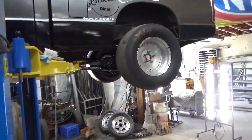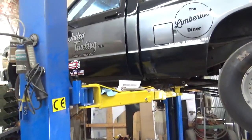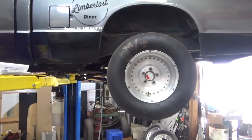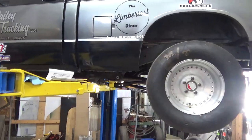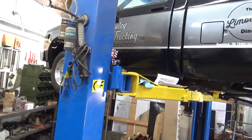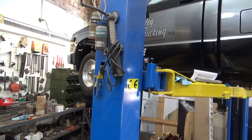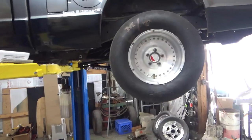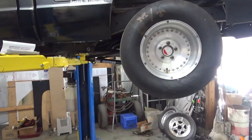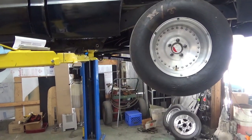If you look at this truck, and I'm going to try to get where you can see the bolt there, and of course the tire's out of the truck 6 inches. If you went from the tire center line through the bolt center, it would intersect up in the front bumper, just like I recommend everything. So that's the best way to do it. At a minimum, get your bottom bar level, okay? At a minimum, never point it up in the air on a ladder bar.